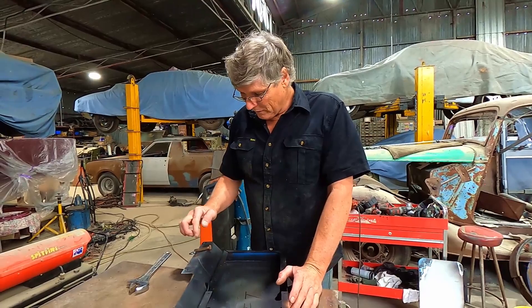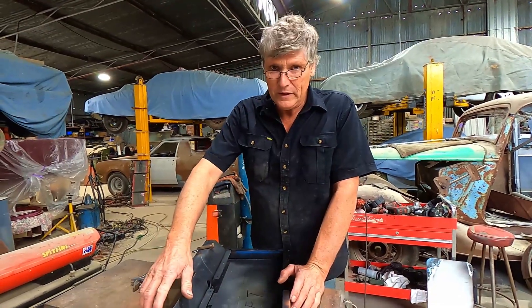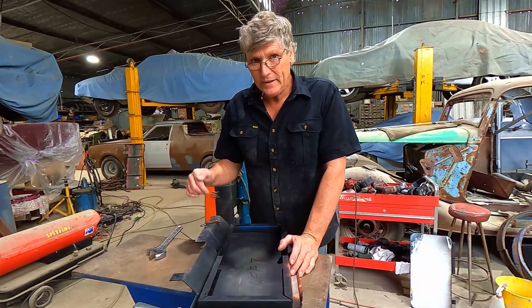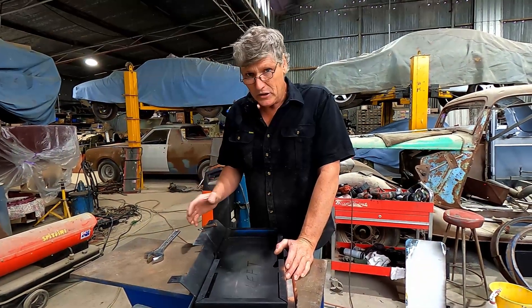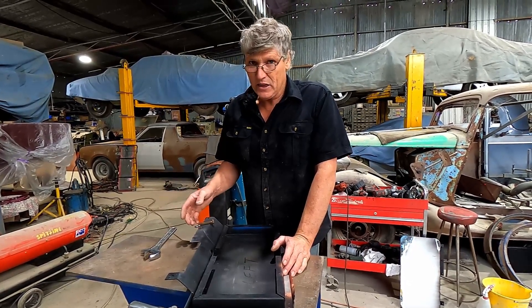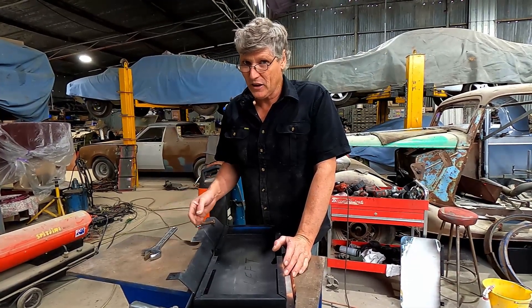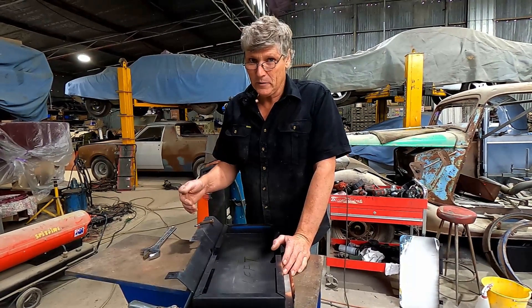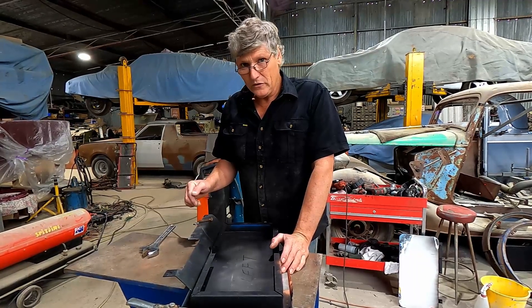So no real fuss at all. We've left our holes perfectly clean — no weld stuck on the edges, no drilling and tapping. I actually use this method most of all for getting broken off studs out and I've done thousands of them — probably tens of thousands. If this method fails, you can still go on to drilling them out, but this is always the first go-to for me. Talk to you soon guys, stay safe.